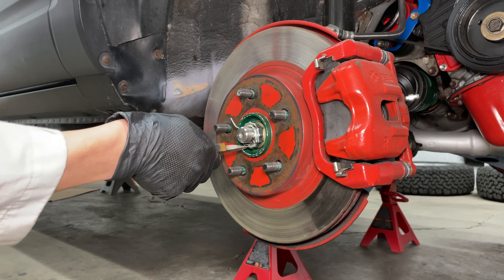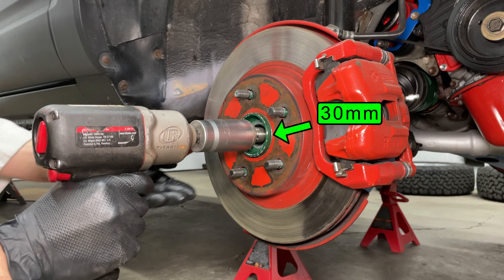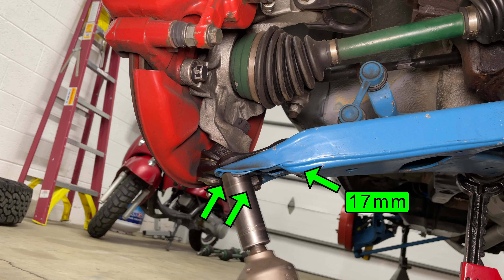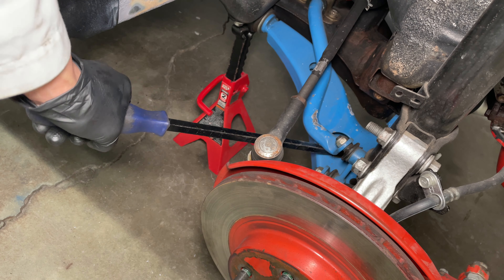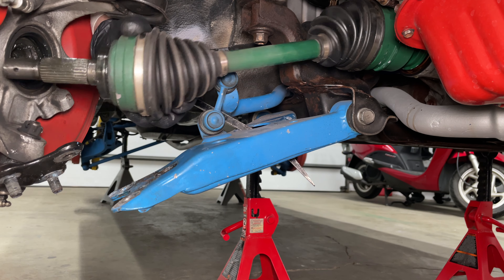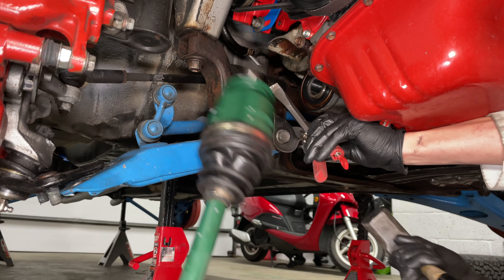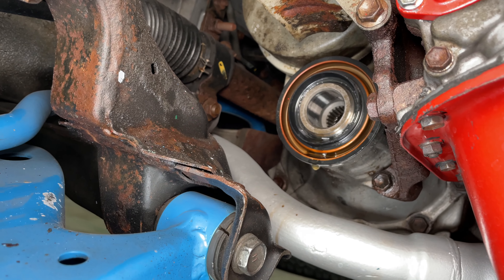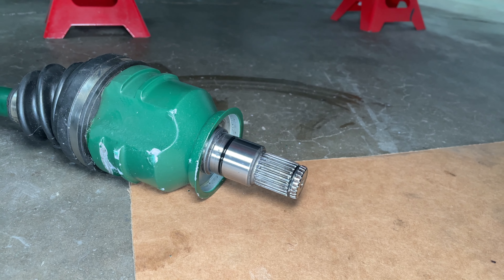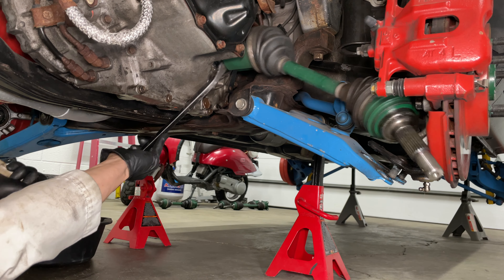Moving on to the front of the car, it's kind of the same stuff. Pull the cotter pin and remove the castle nut from the axle. Use a 30mm socket to remove the axle nut, then make sure the splines are loose from the hub. Disconnect the lower ball joint from the control arm — don't take the strut bolts out so you don't lose your alignment. Stick a long pry bar into the hole in the control arm and push it down to separate the ball joint. Now there's enough room to get the axle out of the hub. Use a sledgehammer and a chisel to push the CV axle straight out of the transfer case. So I replaced this outer seal before with one from Toyota, so I doubt that's bad, but there's a little o-ring here on the CV axle, and I bet that's not sealing correctly. On the left side, I'm using the same technique to get the axle out of the transmission, but I'm using a long pry bar to reach it.